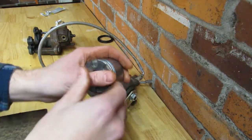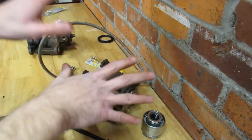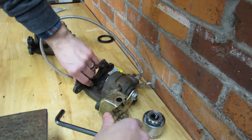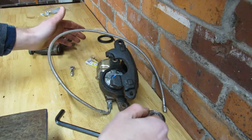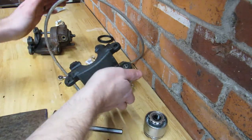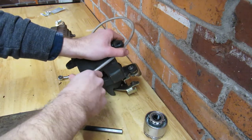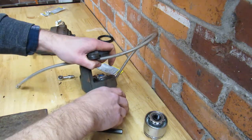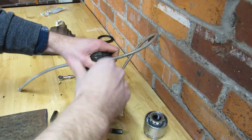This is where I think aftermarket calipers shine. I've switched over the years, rather than going through all of this baggage, to just buying aftermarket calipers. AFCO makes some really reasonably priced cast iron stainless steel piston units that work wonderfully — like $69 bucks, no core required, they look good, they work great, they've got a nice shiny zinc coating. They're wonderful for a budget rebuild. Wilwood and AFCO also make some really good fully aluminum stainless steel piston calipers, which are actually my favorite. They're a little more pricey, but really good quality units.